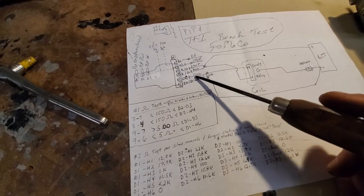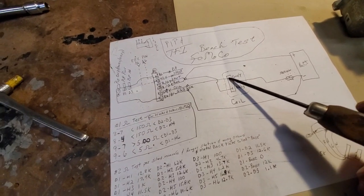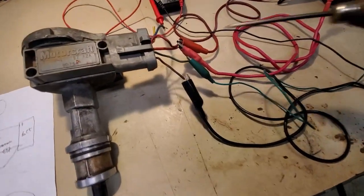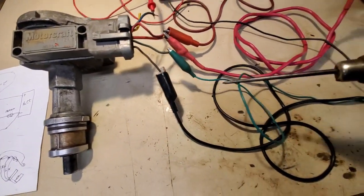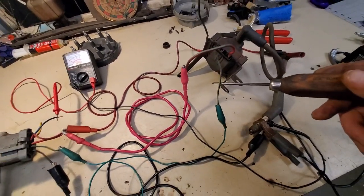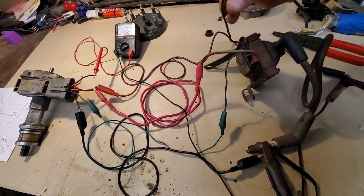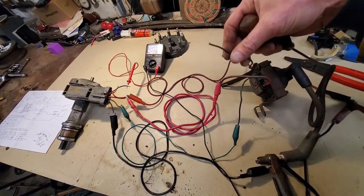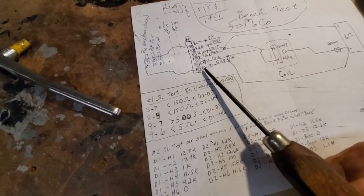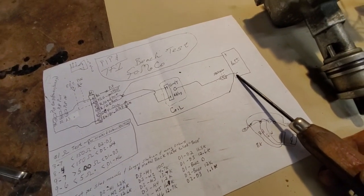The fifth wire down is called the coil lead — that goes to the side of the coil that gets controlled. A ground is given and removed by the ignition module. That's this little green wire here, which travels around and connects right there. On my particular connector I had a spare wire in the same jack. And back to the diagram, my black wire home-runs over to battery ground.